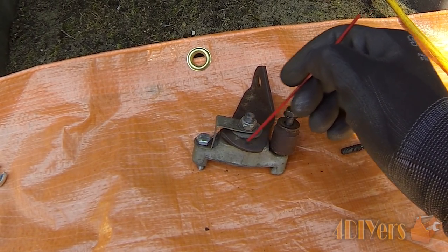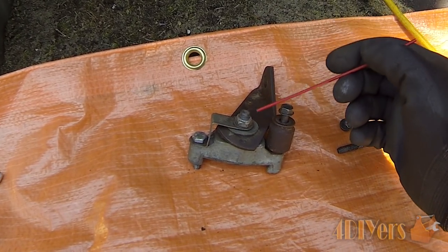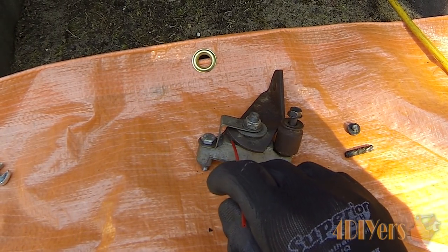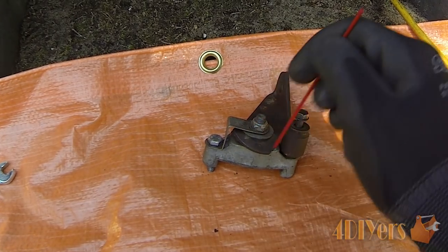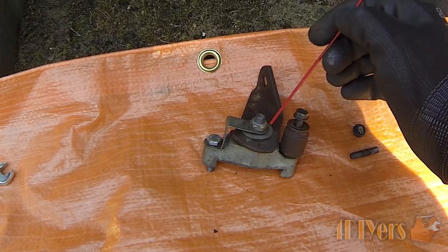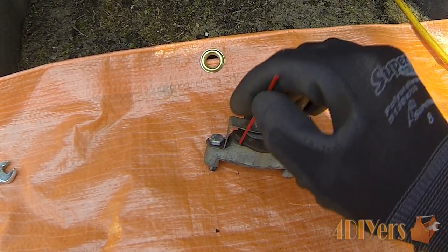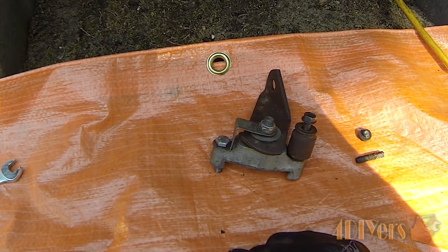You'll notice this bracket has a somewhat odd, concave shape. The pins sit inside and are not touching the bracket so there is no tension on the pad. Once you move the lever, because the bracket stays in the same position, it slopes downward — that pushes more pressure against those pins and activates the pad against the rotor.